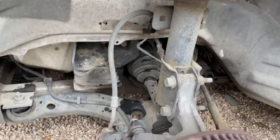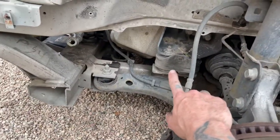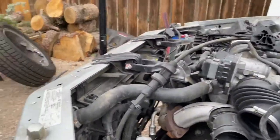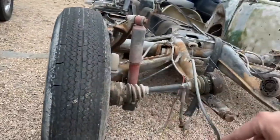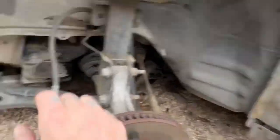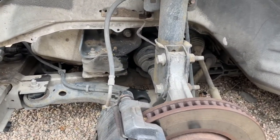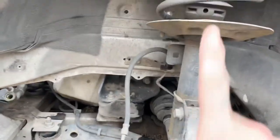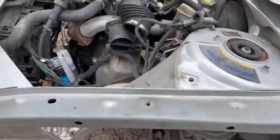Now it's looking like there's just a lower motor mount on this side and one just like it on the other side, and then the two upper engine mounts — there's no upper rear. So I could easily make a cage, tube it, and re-engineer it so the wheels come out right where I want, then build tube control arms and tube shock.